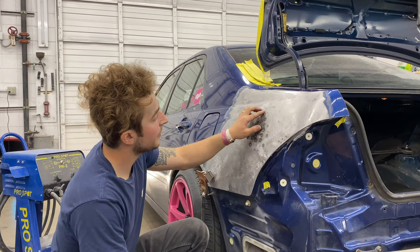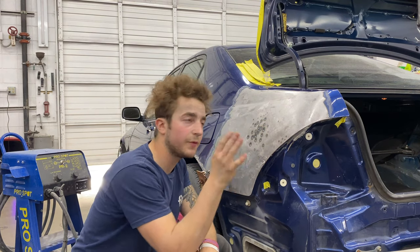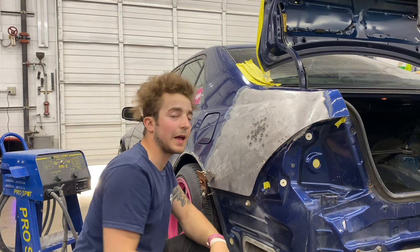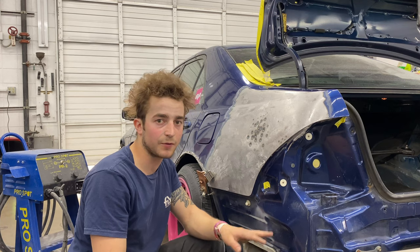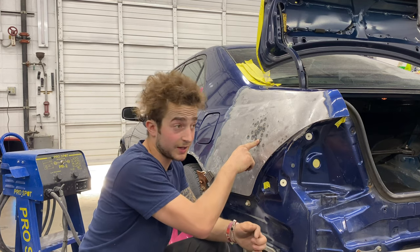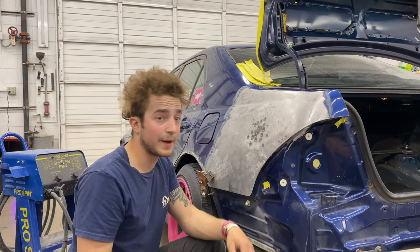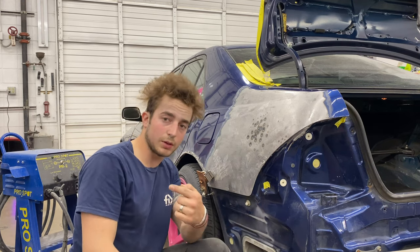I tried to pull it and it was whoop, whoop, whoop, moving everywhere. And when you bond over that, that's real bad because that can crack out over time just from flexing. Or if it's tin canned, it can pop out. So you can finish your bondo, come back the next day, and it's tension, blah.